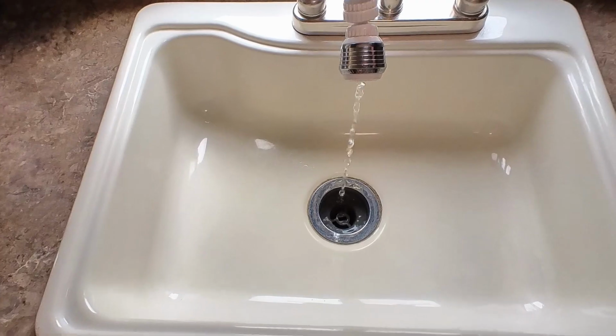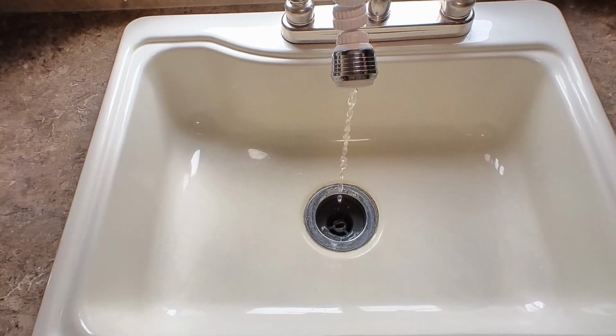The full sensor kicks in at 27 gallons. Just like it did before, I kept filling up the tank to 33.5 gallons. That's when the tank was full. Water was at the sink level, not the top, but at the bottom. So I knew that's where the water was, and I was full. I know that my galley tank holds 33.5 gallons, and the remaining water goes to my shower and bathroom gray water tank. And I also know that I don't have any leaks because I let that go for quite a long time. So that's how I got my KIB sensors more accurate, by removing the sensors and replacing them.